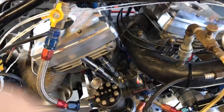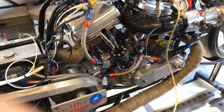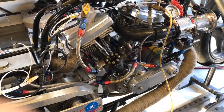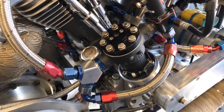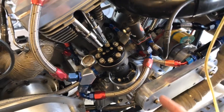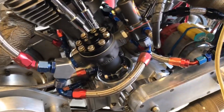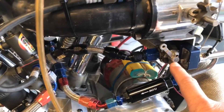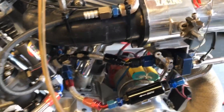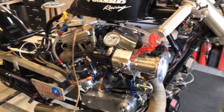The intake manifolds are here. The two intake ports face each other back there and use a common throttle and common intake. It's mechanically injected as far as the pump goes, so we don't have any electric pump pulling off the small battery in this thing. The only things using battery power are the injectors, the lambda sensor, and the ECU. We have a mechanical inline pump driven off of a drive mechanism off the engine. Fuel tank is up on top — gravity feed down to the mechanical pump into the regulator assembly, currently regulated at about 100 PSI. This safety valve is a fuel shutoff valve that cuts fuel to the engine because it's nitromethane and potentially explosive. The sanctioning body requires that shutoff valve, and it's just a good idea anyway.